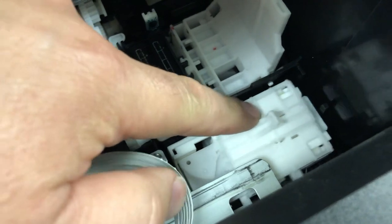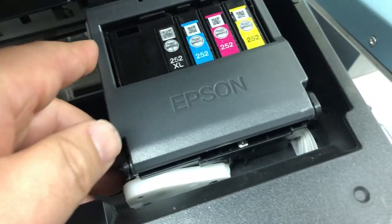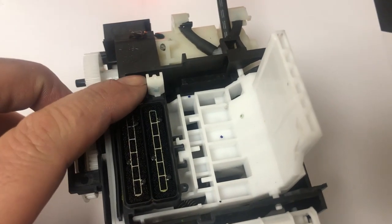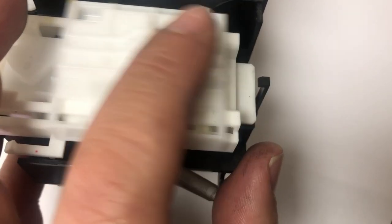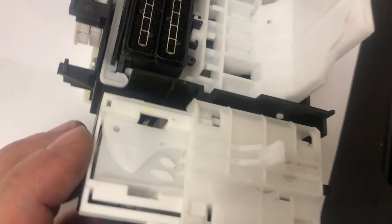It's likely this thing gets stopped and goes underneath the print head. This is called the ink collection assembly. This part can slide back and forth and also go up and down. There are some very intricate magnets below. Basically, if you drop the printer — especially on its side — it could get stuck.